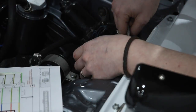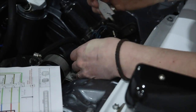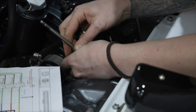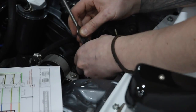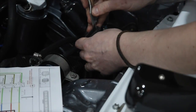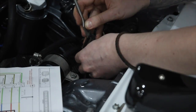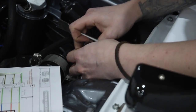Now the next one is front trailing trigger, and that is brown. Now that's the one right at the other end of the pin, this one here. So if we pop that in there, you should be able to feel it click. The difficult thing is you don't have a lot of room to play with, so you've got to try and pull on something you can't really get your hand to. There we are. Okay, the brown one's out. Let's pull that out of the way.